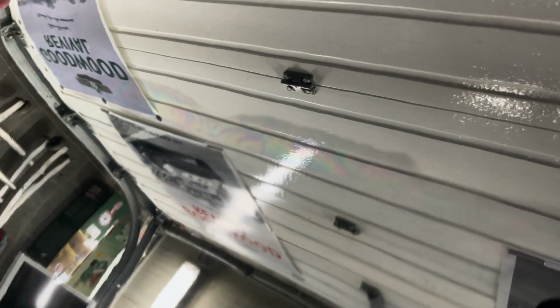When the product is ready to be wiped off, you can see a flashing or rainbow effect too, like oil in a water puddle. We tried our best to film it on the trunk with the reflection of the white garage door, but the rainbow effect is very hard to catch on camera. It's much easier to see with the naked eye. Hope you get an idea what signs to look for though. A rainbow effect, bubbling, or hazing.